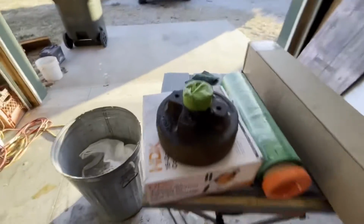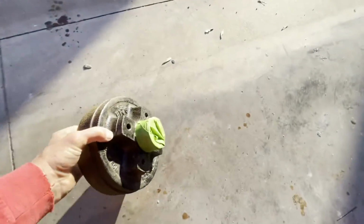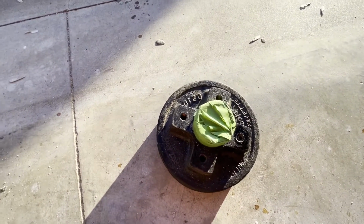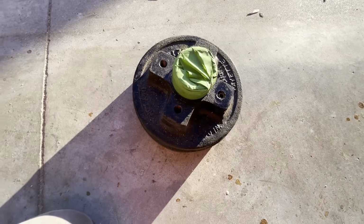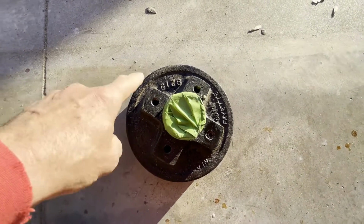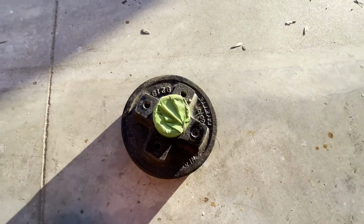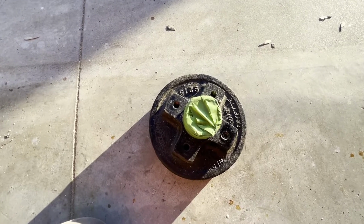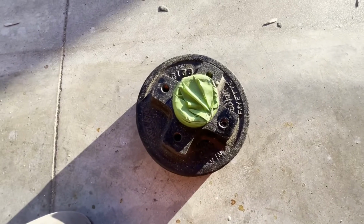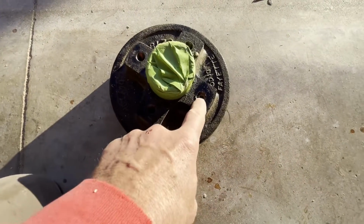Well, we got a problem. Let me show you the problem that we've got. Number one, Scotty being Scotty. Take this out here, maybe in the sun a little bit. They went in 1982 and got the least expensive brake system that they could get. And that's on a 4-lug. And they're not even lug nuts. They're lug bolts. There's 4 bolts that go in here. Big deal, you say. Well, number one, it's a 14-inch tire. It's 4-lug. It's 1982. But anyway, somebody got the incorrect lug bolts and stripped these out, which you could fix.